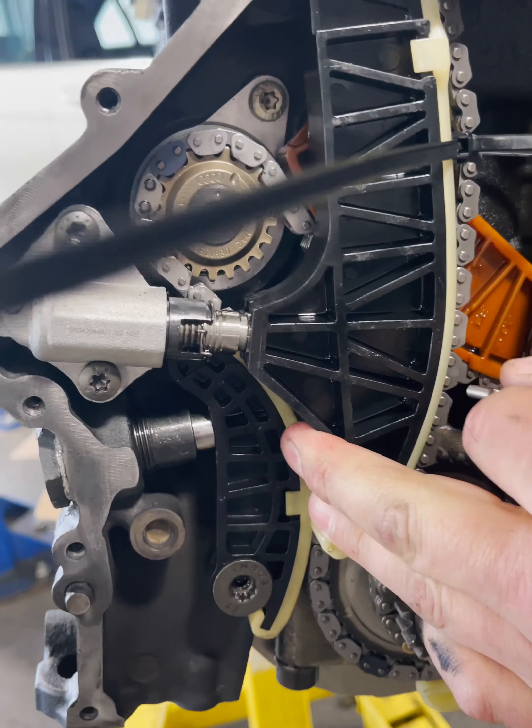Come up here to the gold chain — there are two chains. There's that timing mark right there. Don't be fooled: there's a timing mark there, but if you look up, there's a notch on the top of the actuator that lines up right there. Come back down to the crankshaft — the gold chain is right there. When the motor is timed properly, that mark will be just to the left-hand side of the engine, and that's when you know it's timed correctly. Hopefully this helps you out — peace.